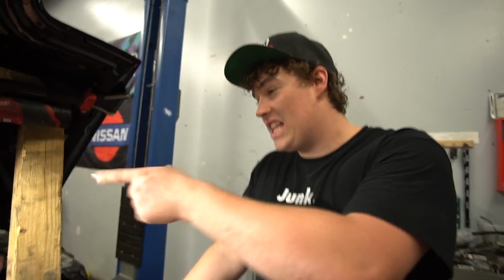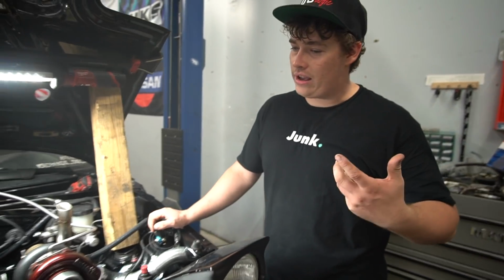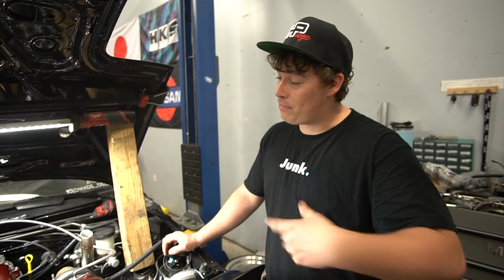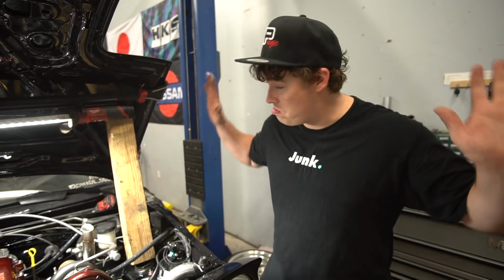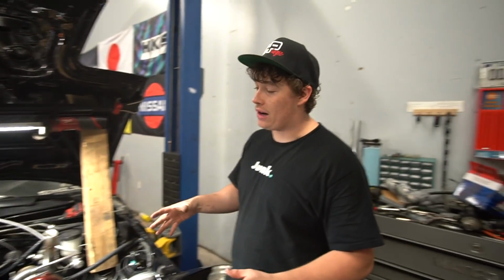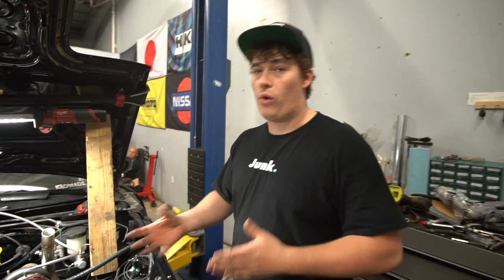And I saw in the corner of my eye an injector harness. I'm like, oh, if there's an injector harness, there must be coil packs. Well, I dig into this box, coil packs, right there. We're just gonna try it. If it doesn't start, we're gonna pop one out, check for spark and everything, and do the whole thing over again.